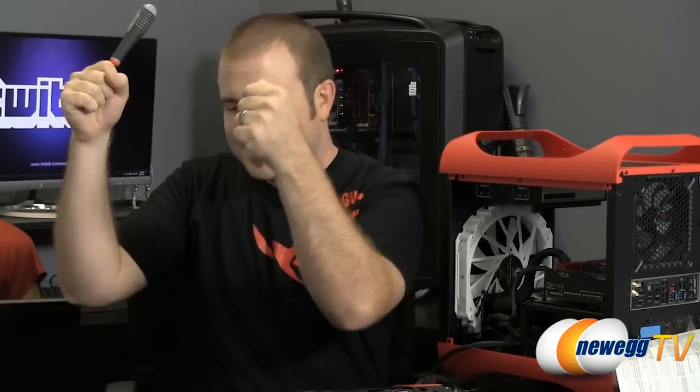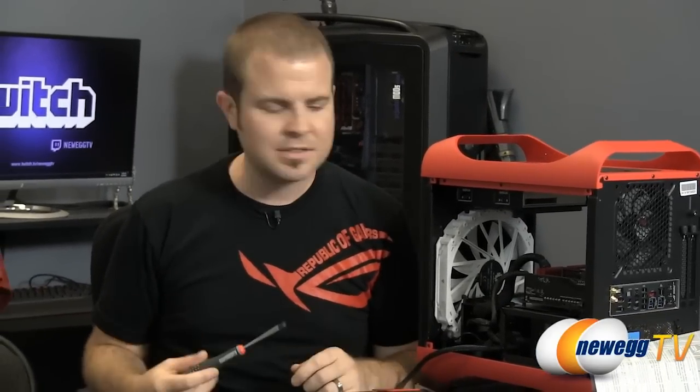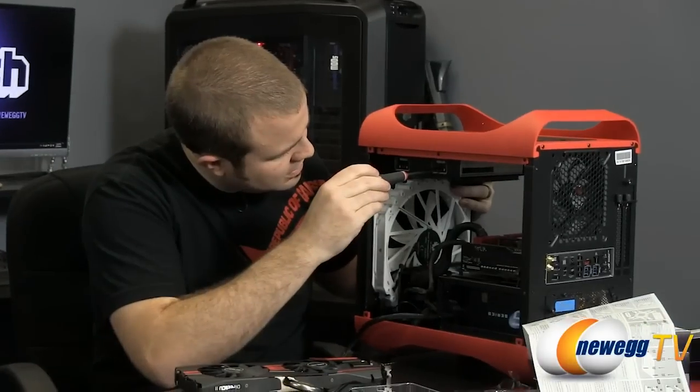I don't want to rant about it too much, but you spend all this money on a computer, and then you set it on the floor where you've got your cat or your dog and dander and hair and everything, and you've got an intake fan creating an area of negative pressure right in front of your case, so it's just drawing everything in, and you're going to get clogged with dust in a couple weeks, versus putting it up on your desk. Not only do you get to look at the system that you built, but you're going to get so much less dust buildup in your case.